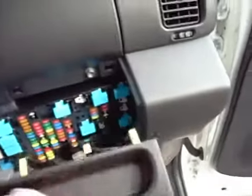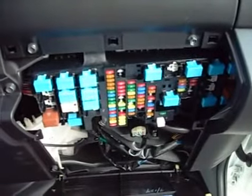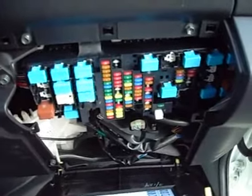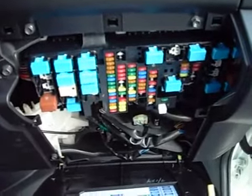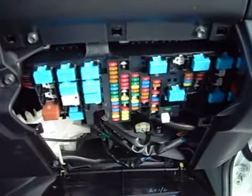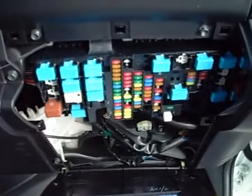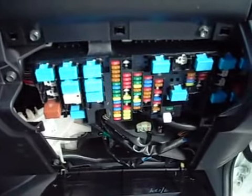One more thing I'll show you that I really enjoy about the Hino is also their wiring. They do conventional wiring versus multiplexing. The difference is, multiplexing, I always explain it as, think of the phone company. Thousands of wires everywhere that run into data links, and you have to rely on the data links to tell you where things have failed. With conventional wiring, it's A to B, so it's easier to diagnose.